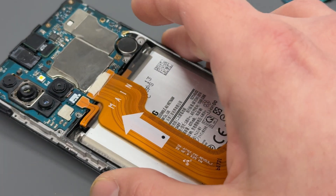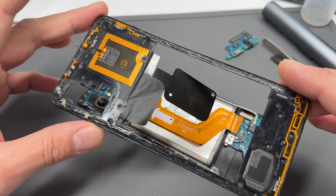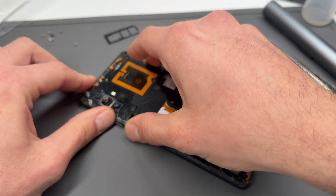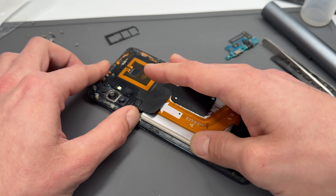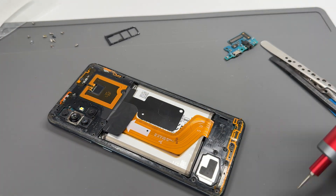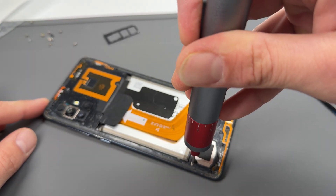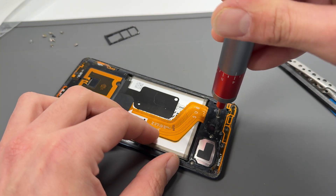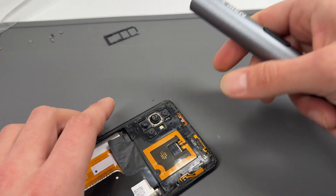I'm just going to reconnect the battery. This would be a good point to test that your device is charging before sealing it back up, however for the sake of the video I will continue with the reassembly. Putting the alcohol on this mid frame cover hasn't done a great deal, but I'm going to put it back on. If you've got the original adhesive on it, it's very easy to remove — you can just rub your thumb along it and it will come off. I'm going to go off camera and remove this with some chemicals and come back once it's cleaned up. Now that we've got the mid frame on and cleaned up, I'm going to reinstall all the screws — let's turn the torque down a little bit, I find that four is probably about right. We've got all the bottom ones in, let's go for the top ones now.